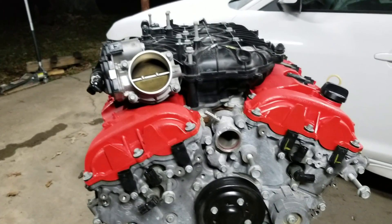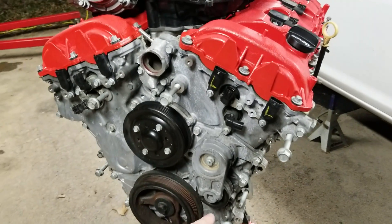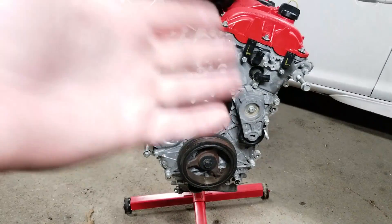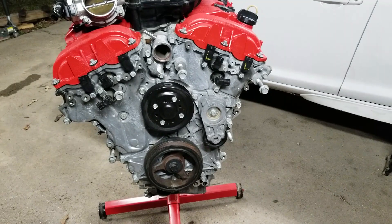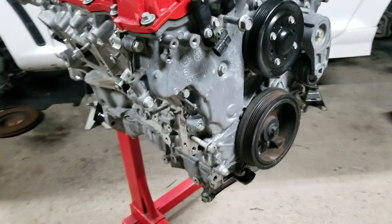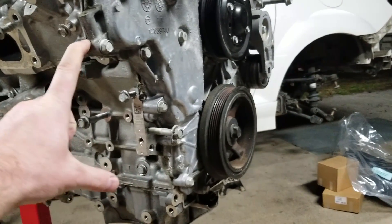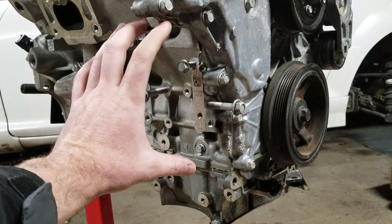So you've got the intake manifold, the water outlet, and then the alternator — which was right here — gets pulled off. If you're doing a custom swap you don't have to move the alternator, but the kit I'm using for the RX8 uses the Camaro setup. There's a bracket that comes down over here — in front wheel drive your power steering pump is here, but with the RX8 we're using electric power steering so we don't need the pump. The alternator actually bolts on over here instead.